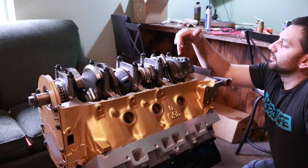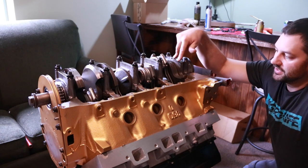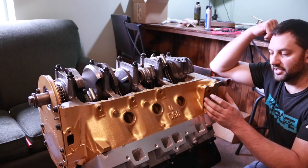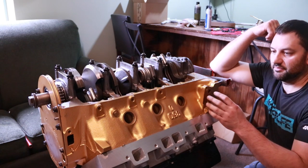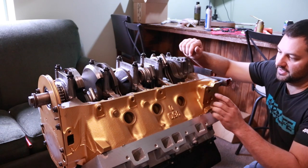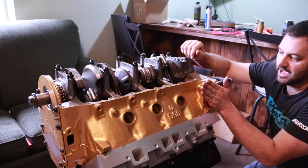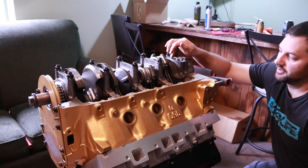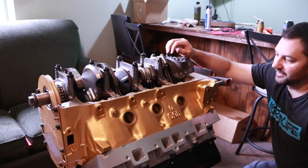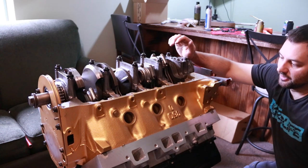I was talking earlier, in the previous video, about capping off this pump face here where the oil pump normally goes. That normally pumps fluid down and then out this portion of the block into what would be the factory oil filter housing. I'm not using that because I'll have a remote mount oil filter. So the plate that I ended up making for this has the feed tube, because I still need to feed oil into the block here, and doesn't have anything there. It just caps it off. So I'm not worried about making a block off plate for up here, because it's literally just going to be open air space in there. And if a little oil splashes up into there, it's not going to hurt anything, and it's certainly not going to leak around the outside here, because I'll just smear some gasket maker around to make that fit.